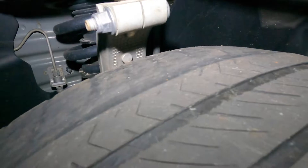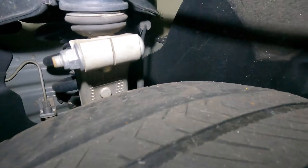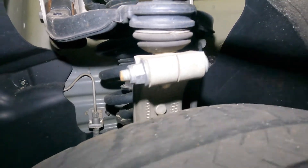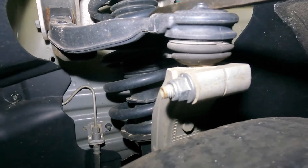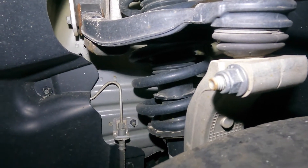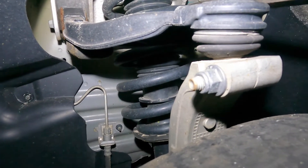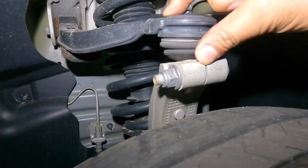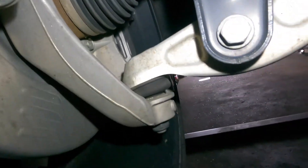We're gonna check the lower and upper ball joints. I usually use my pry bar to check the joints. This ball joint here is shot — this ball joint is shot — so we're gonna have to get this control arm replaced. I can feel play in here. The bottom one is something different to check, but it's most likely the top that's shot. I definitely heard a noise coming from right here.